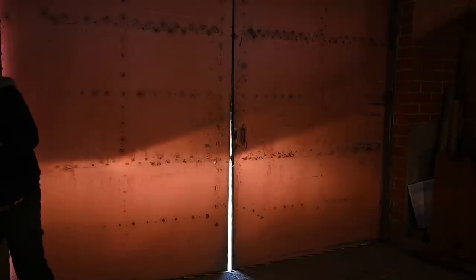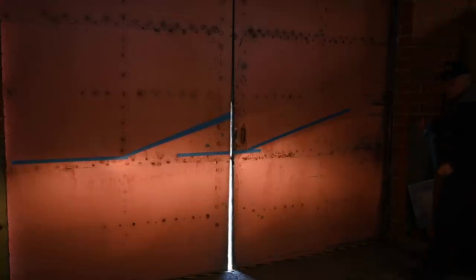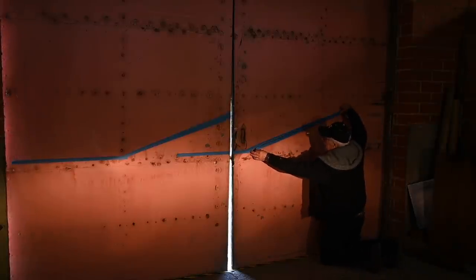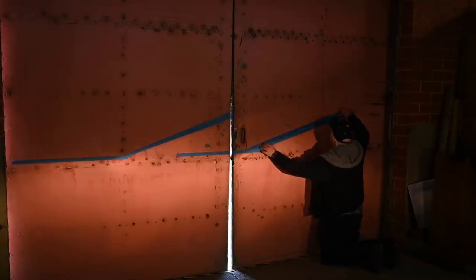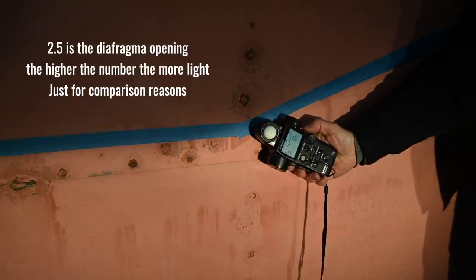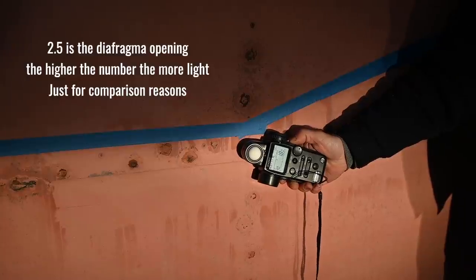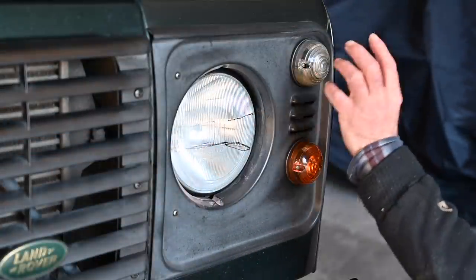What I'm going to do now is tape off the beam pattern on the wall so that once I fit the new parts I can redo the alignment. It's pretty bright in here so it's a bit tricky to see — it's easier to do this in the dark. Now I'm also going to measure the light output. I'm using a light meter from photography — doesn't really matter — and what I see now is a reading of 2.5. Remember that number.